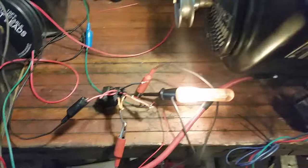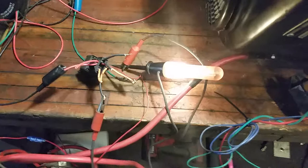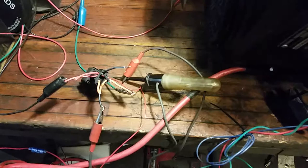So as before, if we go to start it, we don't get any power to the fuel shutoff solenoid, which I am using a test light to resemble. When we go to start it, we need power going to this light — we're going to use that power for the fuel shutoff solenoid.